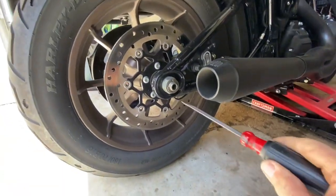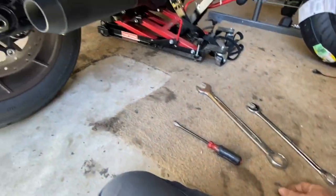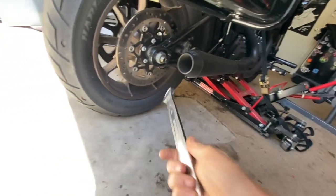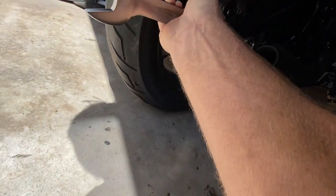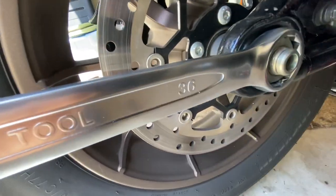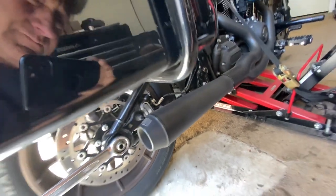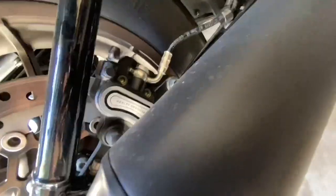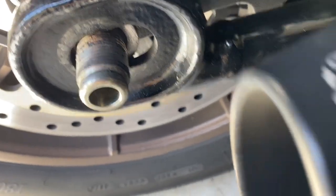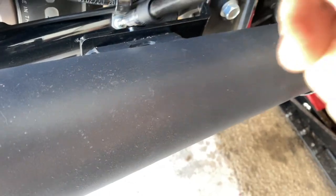It's more the kind of riding I do. I get it on the bike lift, put a strap on it for safety. I take my clip off — there's my safety clip — and then it's a 36 millimeter, get a little more leverage. 36 millimeter on there, break that free, then we're gonna take the caliper off next, which is two 12 millimeter Allens. Got the hardware off the rear axle. This is a brake line retainer, it's T25 Torx — I'm gonna take that out too.